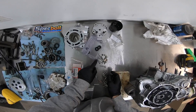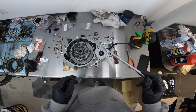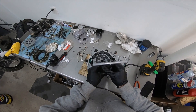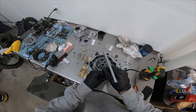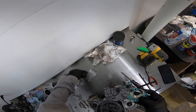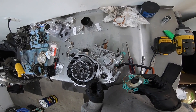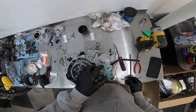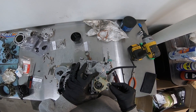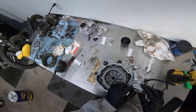The water pump ones are different bolts, so we'll just snug these down and then evenly tighten them down. Now I got the new water pump gasket. Make sure we don't forget these little pins. Got that tightened down — used the impact, didn't really see a need to record that. So now I can put this on there and button this up. I got a new screw for that too.